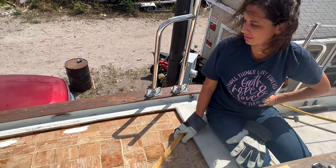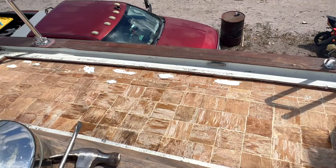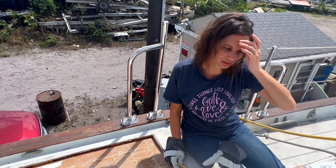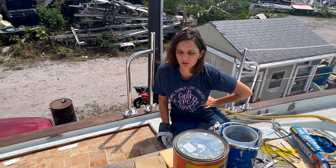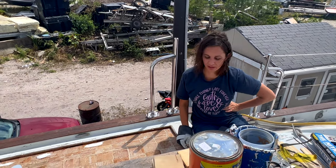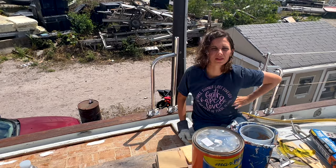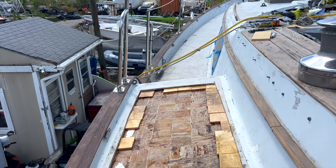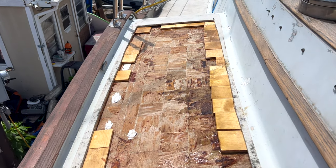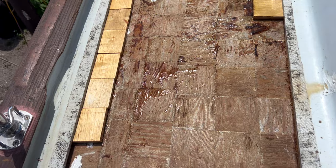So we just gotta put in our new pieces. I know there's other ways to seal the deck without using the woodcore, but it's all woodcore anyway and we've already repaired it with woodcore on the other side. We're capping the holes, I don't see any other way for moisture to get in there. We're putting the squares around the border where we pulled out the wood. We're still mixing up resin and getting that — just dipping them in the resin, coating them, tapping them in where they belong.